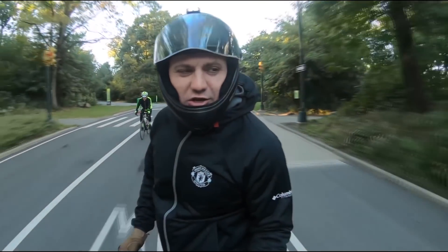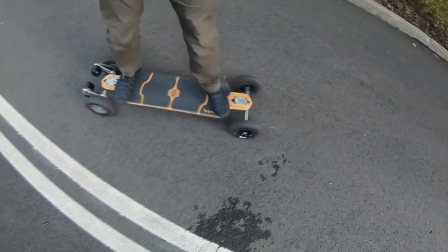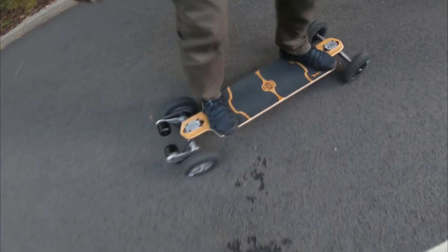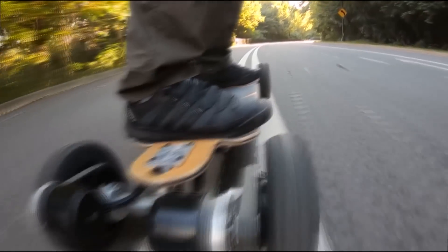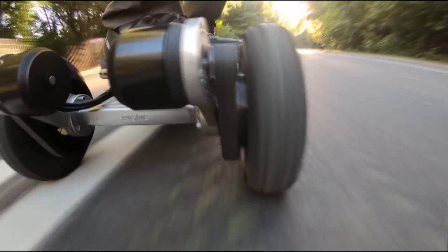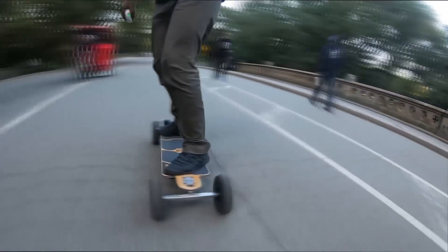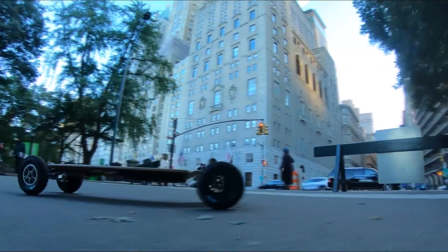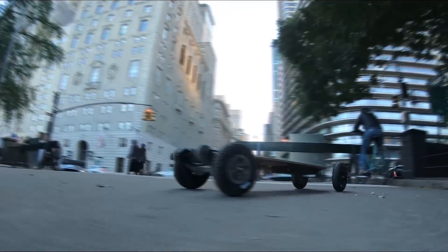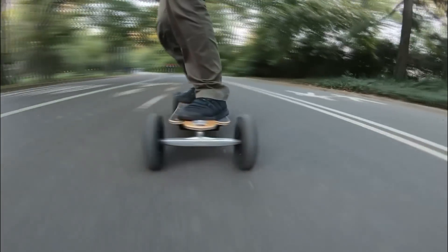The Lacroix deck has a little different construction but it's much, much wider. Being 6 foot 3, I have a much wider stance. There's an inch and a half between the wheel and my foot when the deck is fully turned left or right, and I don't get any wheel bite. This board was made primarily with all the parts I had sitting around. I want to set it for a maximum of 23, maybe 25 miles per hour and get more range. Right now I get around 10 miles per charge with 12S2P, and I'll make an additional pack mounted on top to extend the range to around 20 miles for longer trips.